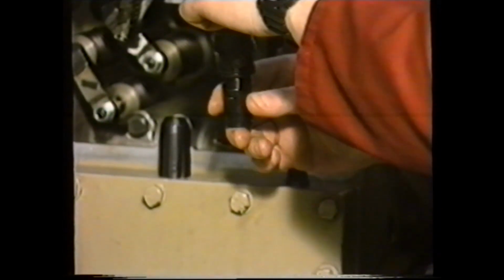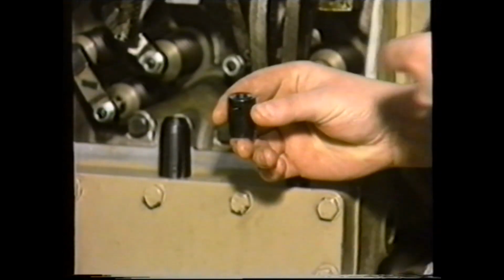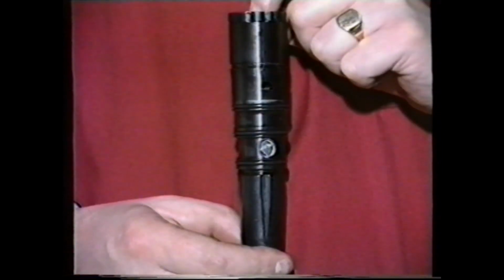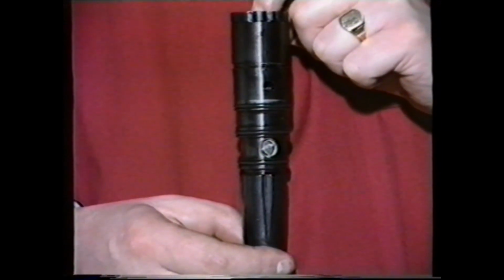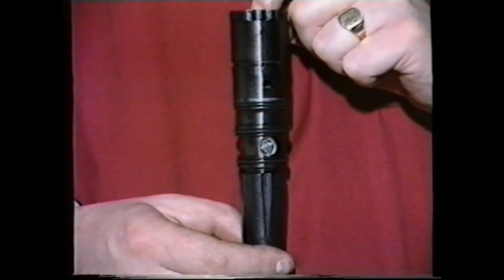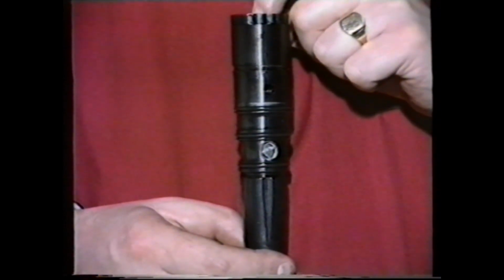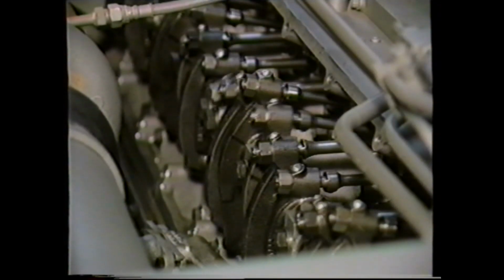Unless the necessary facilities and equipment are available, no attempt should be made to strip the faulty injector. Remember also to inspect or replace, if necessary, the injector O-rings, as specified earlier in this program, as these can contribute towards this problem.